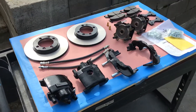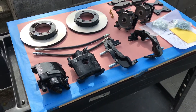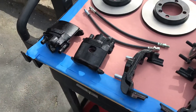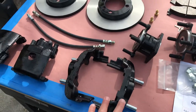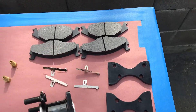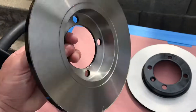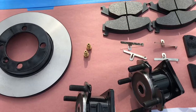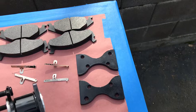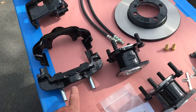Here's our brake kit. Everything in here has been painted, so don't expect it to show up to your house looking like this — you're going to get raw metal calipers and raw aluminum hubs. What we have here are the calipers, and then these — I guess you'd call these the pad holders — they need to be greased and installed. We also have the disc brake pads and these clips that actually hold the pads onto those pieces. It comes with two rotors, new brake lines, and brake line adapters that adapt your stock hard lines to the new rubber lines. These bow ties are kind of the magic in the kit — this is what adapts the spindles on your stock GEM to the new disc brakes.